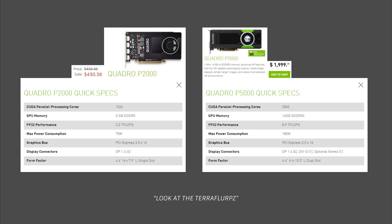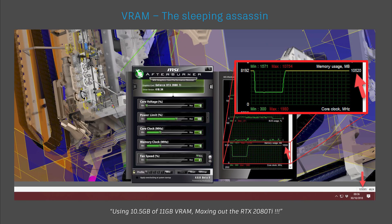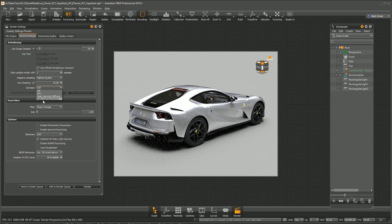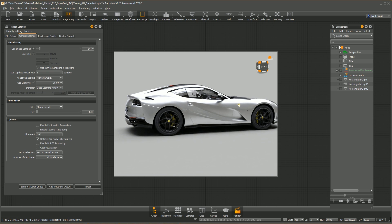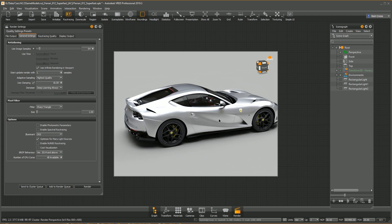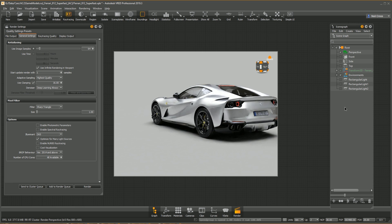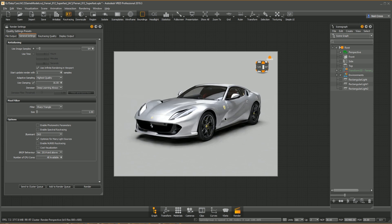So shouldn't we all go out and buy the cheapest, low-end bargain bin GPU for our Inventor workstations? Not quite, for two reasons. First, video RAM or VRAM: although having oodles of VRAM doesn't make anything go faster, if you run out of it you're going to be in for a bad time. Using multiple monitors, 4K monitors, having tons of things open at once — all these things gobble up VRAM. Second, you may use other professional applications which actually do require a decent GPU, and buying a super cheap GPU could be crippling something else. Under no circumstances go for a GPU with 2 GB of VRAM or less.